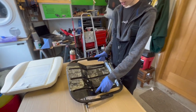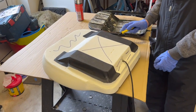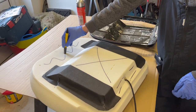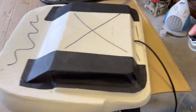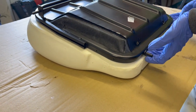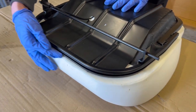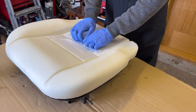You will now need to apply adhesive to this part of the seat base and also this part. You need to apply adhesive round the back, round the edges, at the top and in the middle. Once you have applied your adhesive, you want to start off with the corners, pushing it in and making sure it sits flush with the seat base. At the front, pull it in so it's only overhanging by about a finger, then flip it over and give it a good press down in the middle.